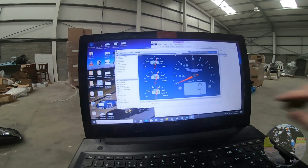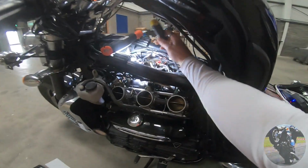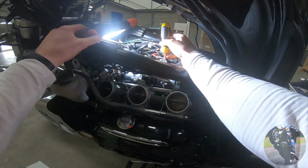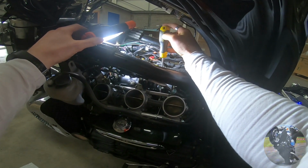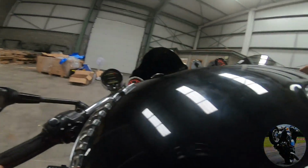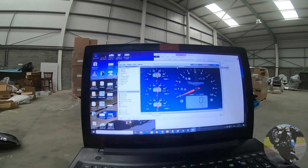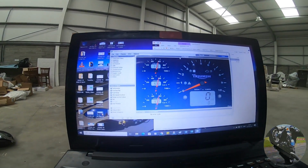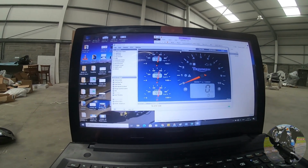bad. So now I'm going to try and adjust this fella until it reads a bit more accurately. So that requires the back screw. So I'm going to go forward a quarter of a turn. Backfire. And I got 570, 580, 570 in the second cylinder, 560, 570, 580.